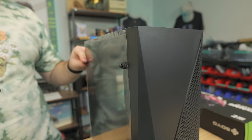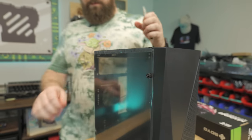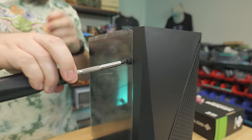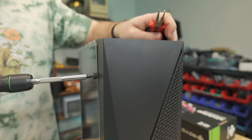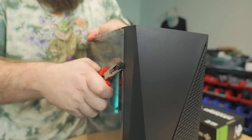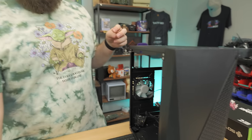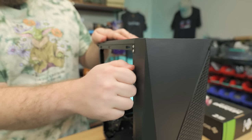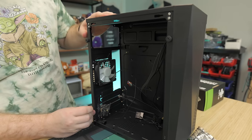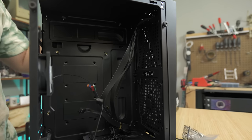We'll go ahead and take it all the way out and see what happens — we might need some different thumb screws. It's always good to have extra tools. Now looking at the inside of this case, I can already tell this is going to be a fun cable management job because with this cheaper case, we don't have a power supply basement. We only have a little bit of room in the back and the rest is going to have to just be bunched up. Let's go ahead and remove the back panel as well for the power supply screws.